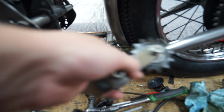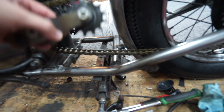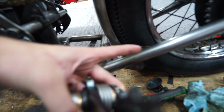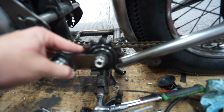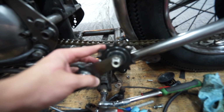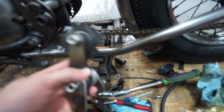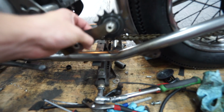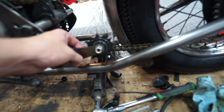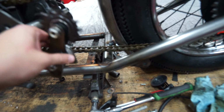The ideal here is that this bottom part of the chain is what the tensioner rides on, so not the top but the actual bottom part, and the chain is going to be traveling this way. So you want this tensioned over, I know it's kind of hard to explain, this way, pushing back at it so that the chain's rolling over the top and not jabbing into it and getting pulled. So anyway, it needs to be mounted towards this direction, kind of leaned over. But as you can see, I don't really have the ideal spot for that.